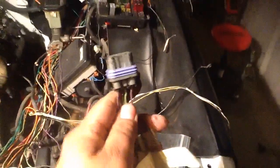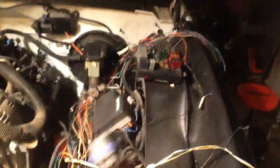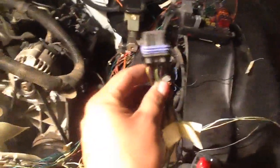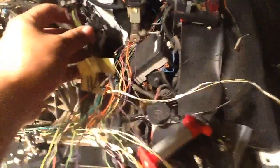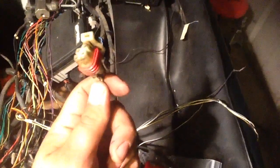For those of you asking what to do with this — just to recap — the large connector, I've gone through and labeled the wires. I'll put the description of what each one of these wires represents, the ones I was able to identify. But largely it's going to be untouched, with the exception of the starter relay wire. And you want to keep your range selector switch. It's kind of a funny-looking connector — it's kind of offset.